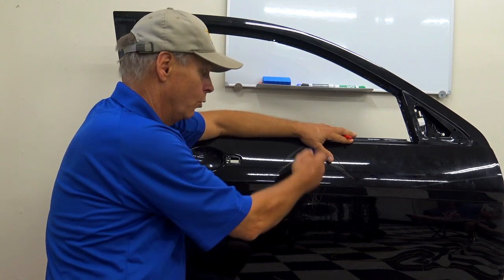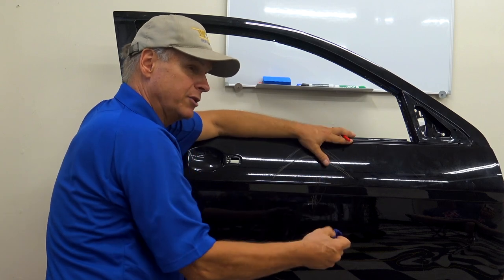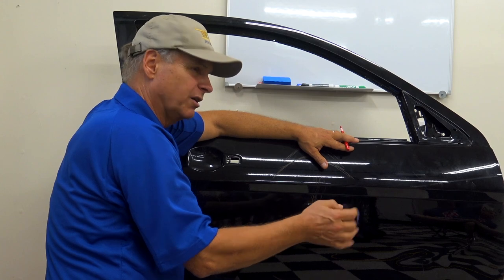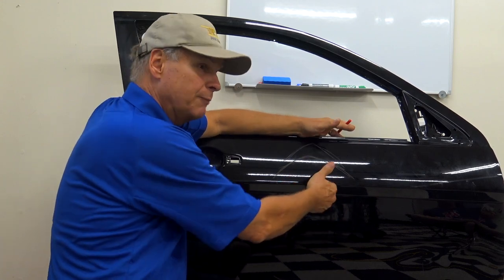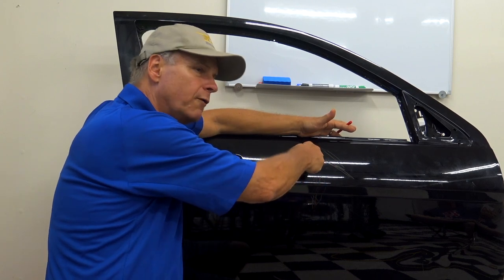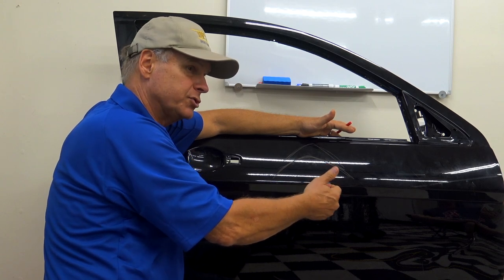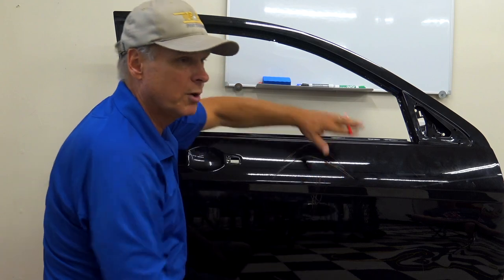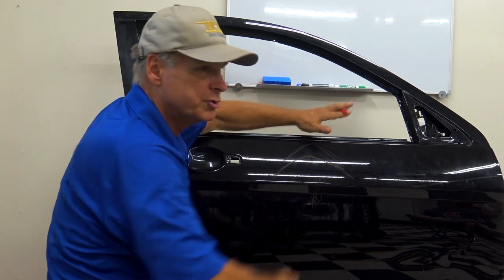Okay. Now, what I do is I watch the tension on this while I'm having the pressure go down. I'll thumb the strap a couple of times, and if you can tell the pressure's starting to let up, absolutely I'll put another 50, 75 pounds on that. But while I'm doing that, I could care less about the body line. I'm not even watching it. I'm just totally focused on my crown. And as that crown keeps moving, I'll go. If it stops, and it almost always does, I stop and continue washing it down. So I do the same thing. I continue with that tab down until everything's washed into that body line.